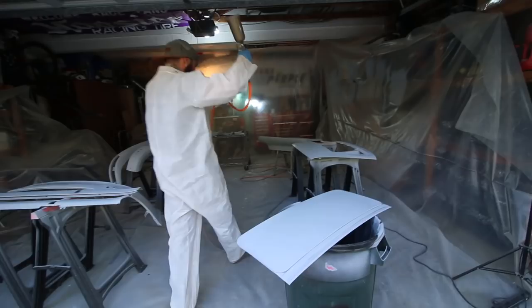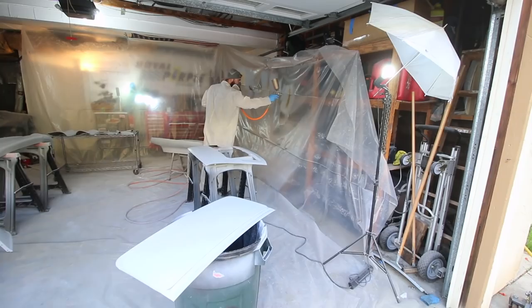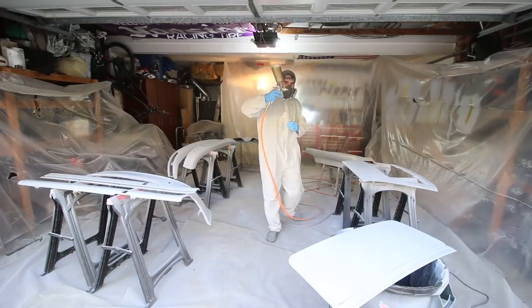Race against daylight. We probably have to finish this with the garage shut and the lights on, but everything's been sanded again. We didn't put that in the video because we hate sanding, but we're ready to actually start laying on the coats. I'm going to film the same exact technique as before. Right now Devin's making sure the gun has a good spray pattern, and it does. These guns are pretty good — it's a Harbor Freight gun, surprisingly. Don't get the purple one, get the silver one. It's a little more expensive but worth it. We've had this one for like four different paint jobs and it's been great every time.